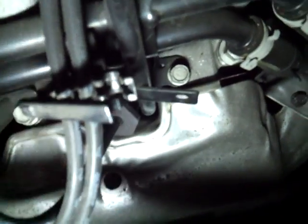Let me show you another cool trick. You can also check for spark using a spritzer with soap and water. All you have to do is spray it on the suspect ignition wire and you should see a little firework display. That's also best done at night.